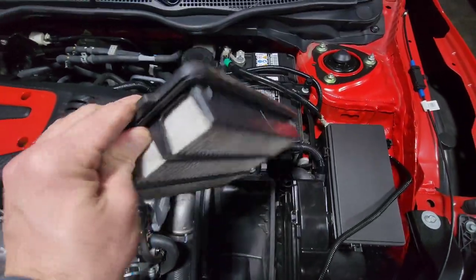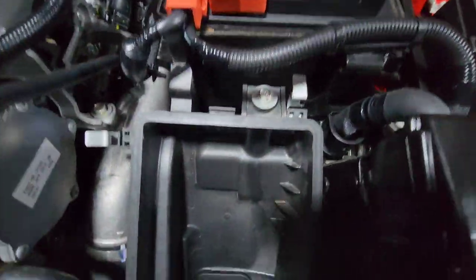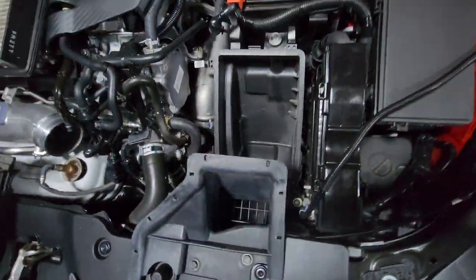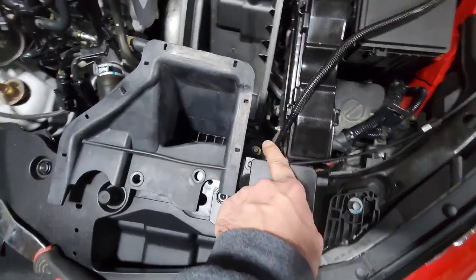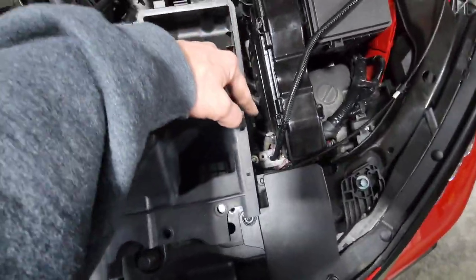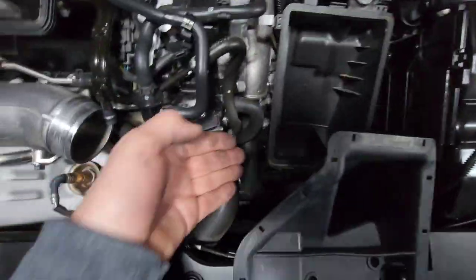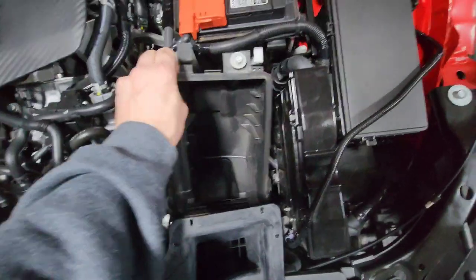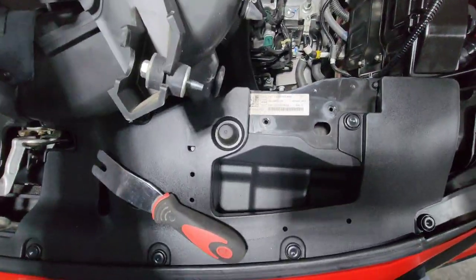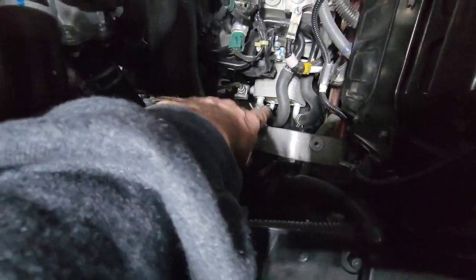See how dirty our air filter was — not too bad at all. Now your lower box has to come out, which is going to have a 10mm here and looks like a 10mm right here, plus these two 10mms. This should pull out as a unit. Once you've got all four 10mms out — that one's pretty deep so you'll need a deep well — these two come out but these two just loosen up, they stay on the bushing. Once you get them out this won't lift straight up, the easiest thing is to get your hand underneath and force it up.